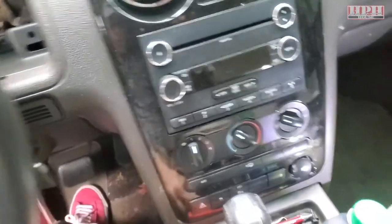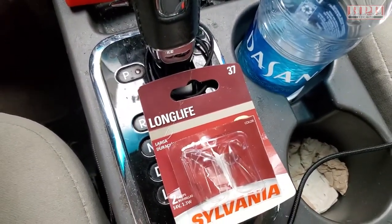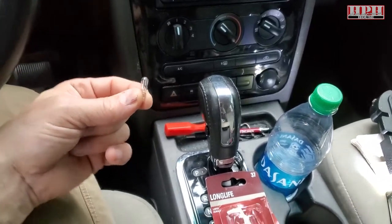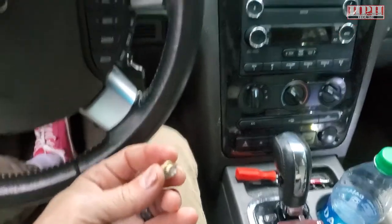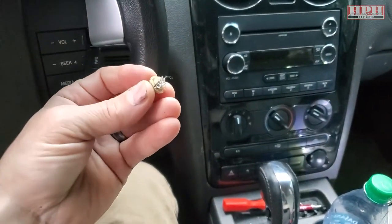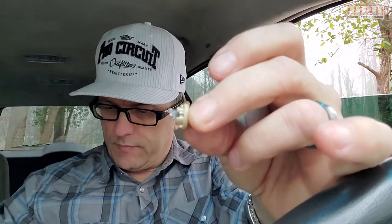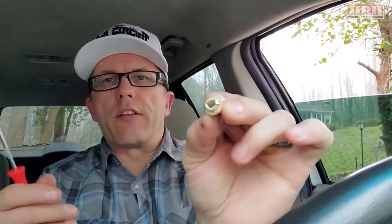Some of those little bulbs are tiny — I believe it's the number 37, I'll put a link below. It's an itty bitty little bulb. You do have to remove just the bulb, and if that bulb will not come out by hand, be careful because they will break. The bulb can be a little tricky to get out of the socket. The easiest way, if you don't want to break it, is to get a little pick — something really slim and skinny — and just go around the side of it and pry it out like so.